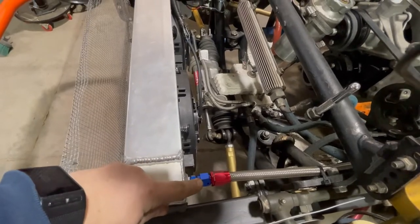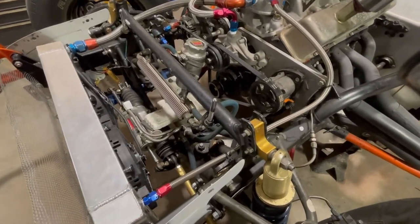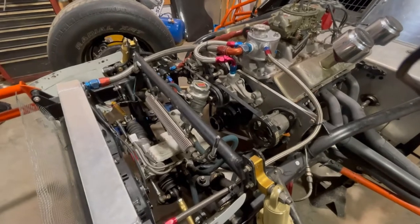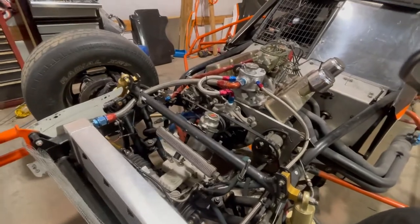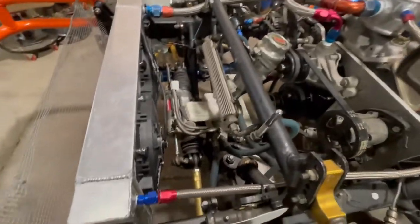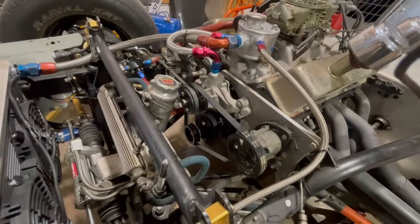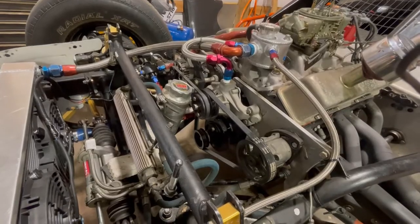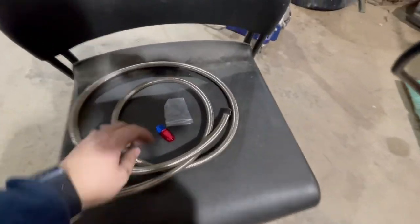On the exit side of the radiator we put a new stainless hose with JIC fittings. The main reason I did all this is that at the racetrack, if you have issues and need to change out a radiator or do any type of work quickly, it's really easy to break these fittings loose and disconnect everything within a matter of seconds. Before, I had plain rubber hose with hose clamps and you had to undo those - it was time consuming and aggravating trying to get off those slip-on style barb fittings.